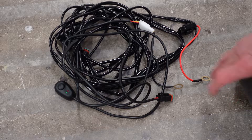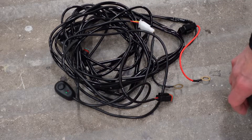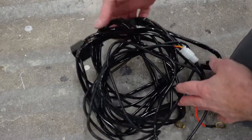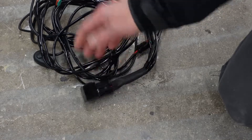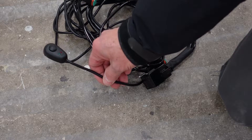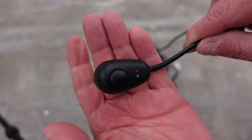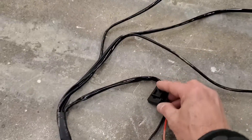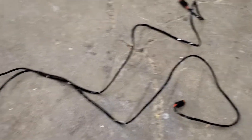This is the harness aux beam gives you — it comes with the kit, and it's a bit unusual. The plugs are great, weather-sealed, everything's awesome. It comes with a relay, which is great — all wired up nicely, no problem. This is your on/off button, and you'd have to feed this into your car through the firewall, which is a bit of a thing. It's about the size of my thumb. There's your relay, your battery connection, a fuse block, two wires going to your lights with tons of cable, and this switch that controls it — but it has power all the time.